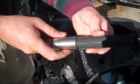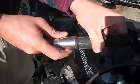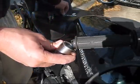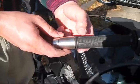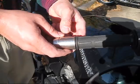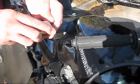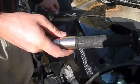Now see, you've got that small amount, and so you test it — is it pulling on the collar of the throttle lock when you turn it? Answer: no. So this would be ideal. You almost can't see the clearance, but yet there's no friction. You almost won't get it that good; it's very rare. Just to let you know, sticking in another shim and pressing it against, you have this certain clearance. Now this is not unacceptable — most bikes will run just fine on that level of clearance; it's about 40 thousandths of an inch. But if you go up one more shim, that's too much for sure, so you'd have to take a shim away. On mine, it looks like three shims was just a really lucky shot — it was ideal, which you seldom get.